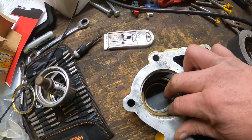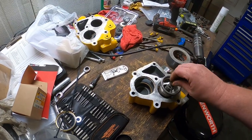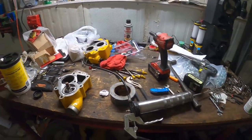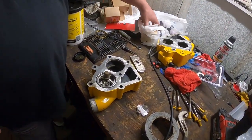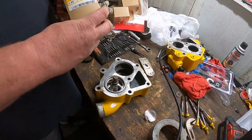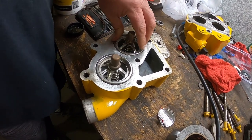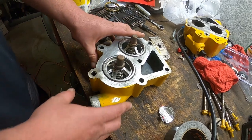...is get these seals down in here, which I have already replaced. Let's put new thermostats in. There's the part number for the thermostats — I think I paid $67 a piece for them. Although the other thermostats were good, it just seemed better to do it while this was all apart. Those thermostats are in.